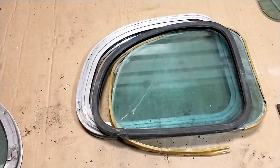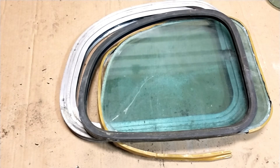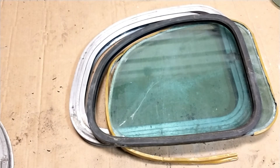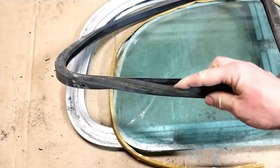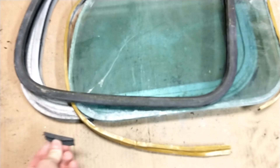We brought all the window frames home and I started taking them apart. This one's been stripped apart, and I'll show you what is actually inside one of these D windows. It's a double-sealed window. So there is a rubber seal, this rubber gasket, which surprisingly is actually still pliable, because all of the other rubber on the bus is just solid as a rock. This actually came off the outside of this frame and it's solid as rock, but this is still quite pliable — I could actually reuse this one if I wanted. But I won't; I'm going to get all new ones.